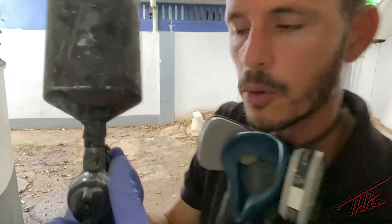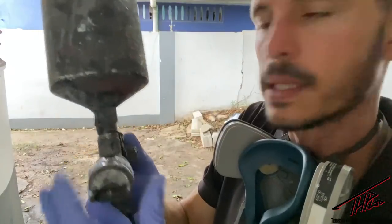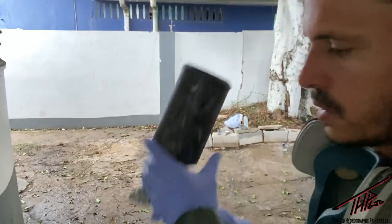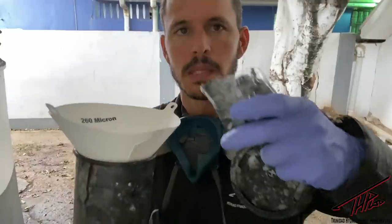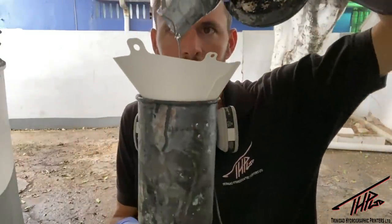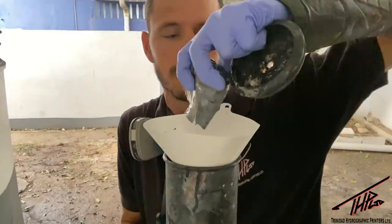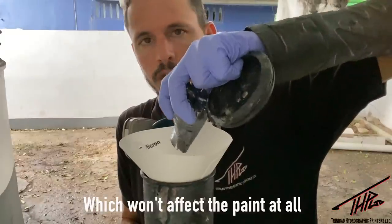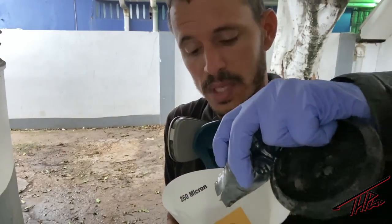I'm not going to bother to clean out the bottle with thinners — I'm just going to pour the base paint right in. As I just showed you guys how to mix the base paint with the 2K reducer, I'm going to pour it into the paint gun. I didn't bother to rinse out the gun because the adhesion promoter is colorless and it's also in very small amounts, which won't affect the paint at all. It might actually help it to hold to those wing mirrors since I didn't use any primer.